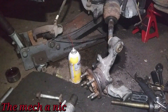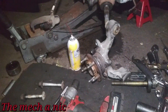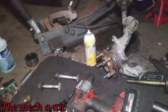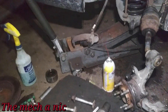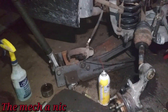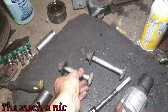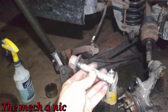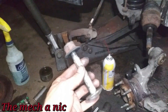At least it's from AutoZone and it's got a warranty. Here's a pro tip: if a nut and bolt fight you all the way coming off, when you finally get it off the car, don't just slap it back on. Take the time to clean up the threads.